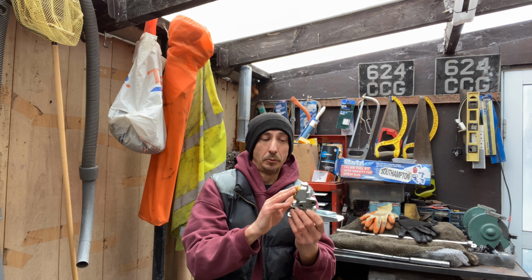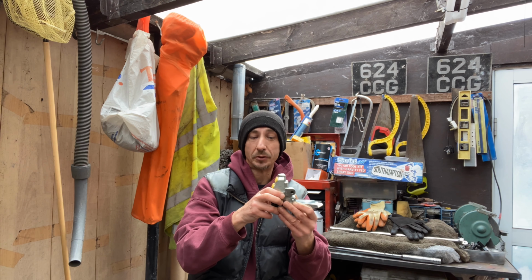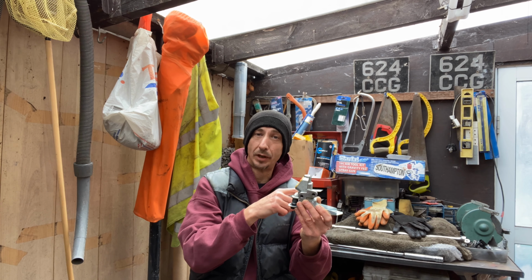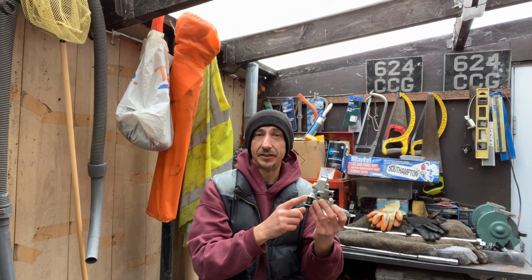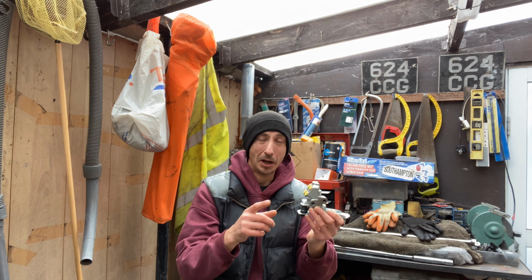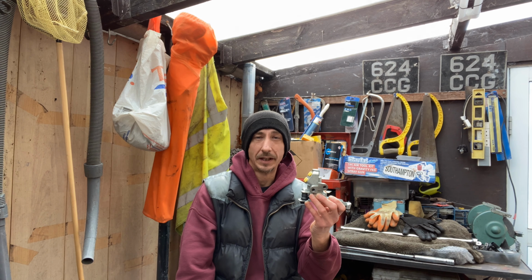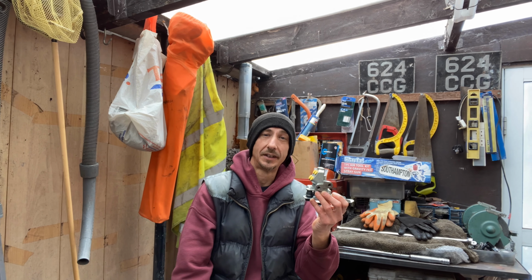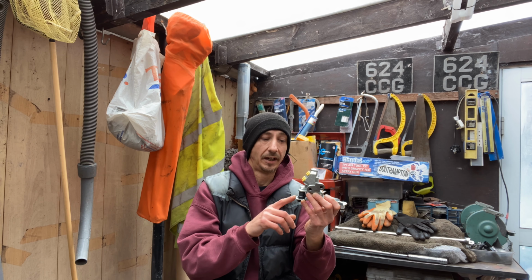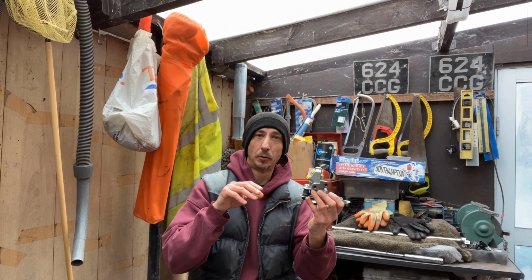Okay, so depending on how much weight is in there, so when you load your vehicle up and the vehicle goes down, this valve is going to open more to increase the pressure on the rear brakes. Now, what this does is it stops you from locking up the rear. And I know nobody seems to adjust these when they lower their vans. And the only way to set these up is to get your vehicle to standard height, and then you can set them up correctly. So everyone who's got lowered vans, you can't set these up correctly until you actually bring it up to height, and then you can set up all the pressures.